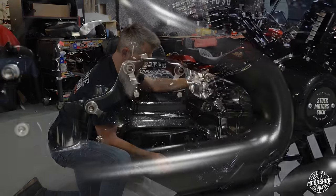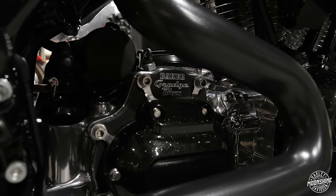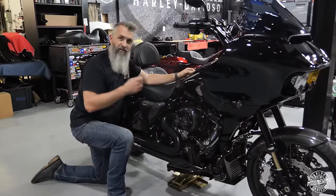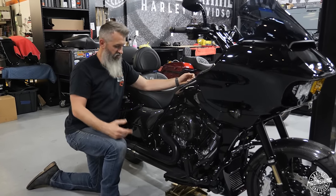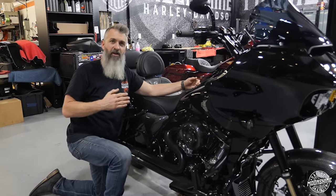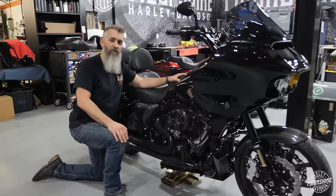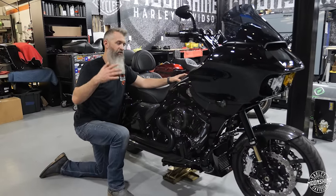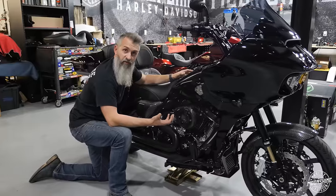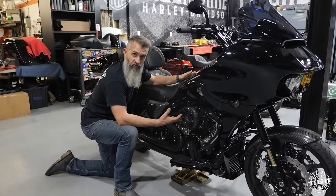The Baker transmission right here — we have a six-speed Baker, and the Baker is nice because it comes with a warranty and is a more robust transmission. When you have something making 170 to 180 horsepower, the taller gears in fifth and sixth in the Baker are really nice to have on the highway. Baker's fifth gear is equal to Harley's sixth gear, and Baker's sixth gear is an overdrive ratio compared to Harley's. If you're running over the speed limit, you're going to reduce your RPMs — you can cruise at 90 around 3,000 RPMs instead of above it. We can also adjust the rear gearing to offset the taller ratio from Baker's fifth and sixth.